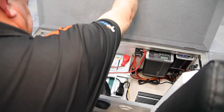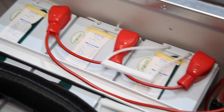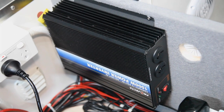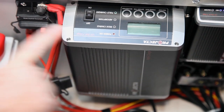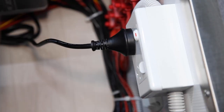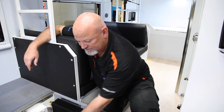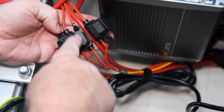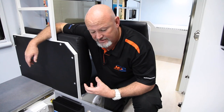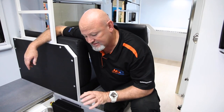If you need to get into your batteries or battery systems or the electrics, it's under your mattress. Pop the latch open — you've got three batteries in here, 300 amp hours. This is your modified inverter — a thousand-watt modified. You've got your 240 charger here and your DC-to-DC charger. Your 240 charger must be plugged in and turned on so it can take current. In this little box are fuses: one for your radio, one for your gas alarm, and one for your breakaway unit. Check all your manuals and wiring diagrams to see which goes where.